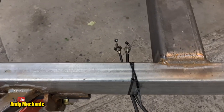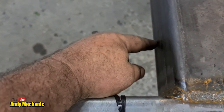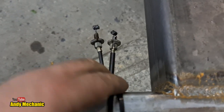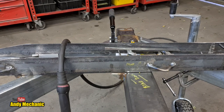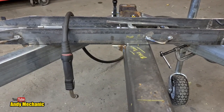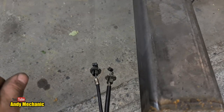So looking down from the top, what we need now is a bracket off the side of here, welding to here, which I think these probably will move across a little bit further that way, to make sure that they're equally spaced and the center line between the two is bang in line with the coupling on the bottom of the handbrake. So it's a nice dead straight line all the way down to the balance bar and of course to where the cables are mounted.